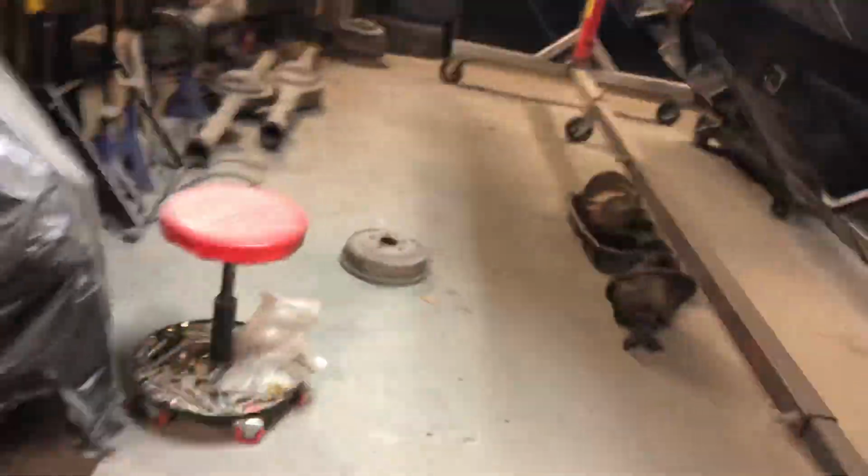I had to split these because the original ones were too narrow. These, I'm sure, are more wide. Let's see. Yeah, so they're wider. That has play. The other ones were made to fit this. The Detroit Speed is wider. They would not fit over them. So that's the next step of welding on the underside.